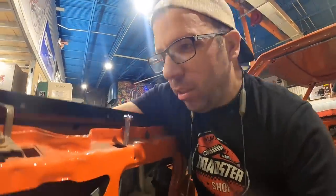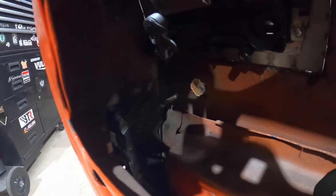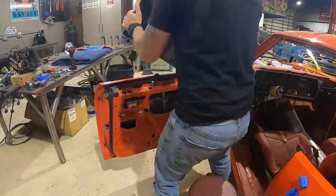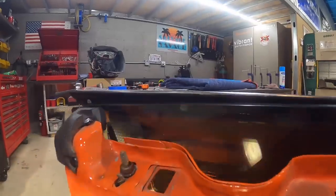We went ahead and used some stainless steel filler wire for mock-up on the linkage, but it's not lifting it up quite high enough — the angle is too severe. This mechanism down here hooks up to the inner door handle. If I weld a tab straight off the edge coming straight out, I'll be more in line with our lever up here and can run a linkage straight down. Before I bother with that I need to put the glass back in, because that could be another issue. Good thing we did, because the glass would not allow me to go on the other side.